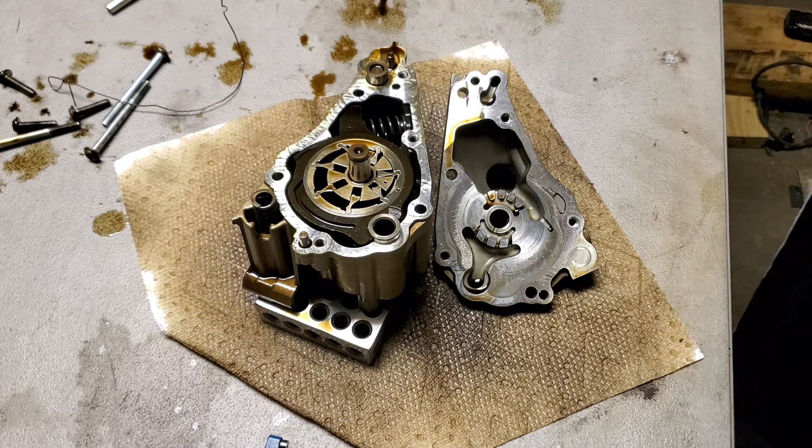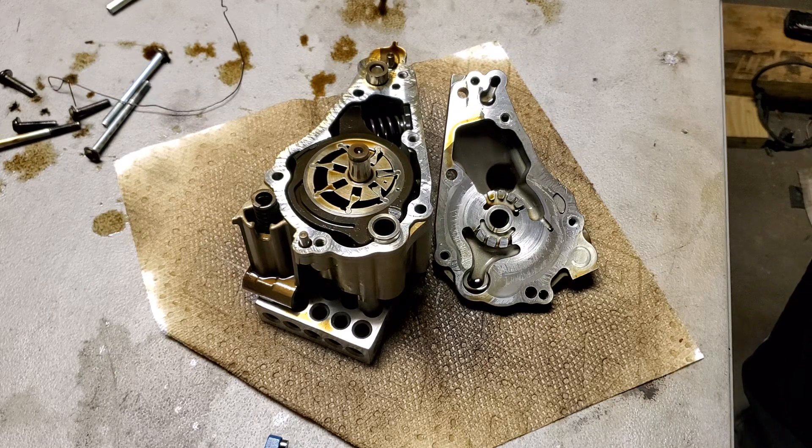Further evidence is that BMW actually matches bearings to each of the rods — presumably because they want the oil leakage from each rod to be as little as possible. This way they can ensure the engine is matched to the minimal flow rate of the oil pump. So if you replace your rod bearings with aftermarket bearings that are not matched to each journal, your leakage is going to be high and your oil pressure will actually drop off at some points depending on your driving habits, causing those rod journals to touch the bearing.